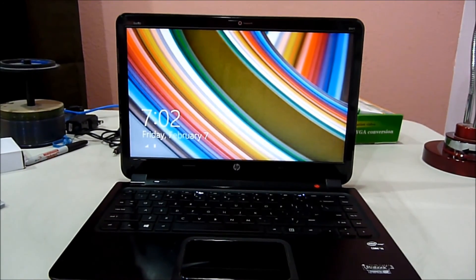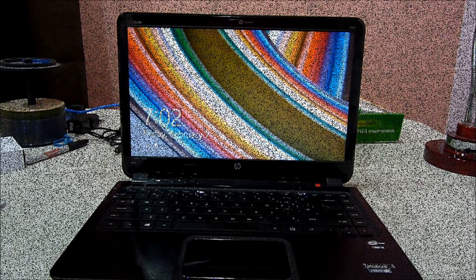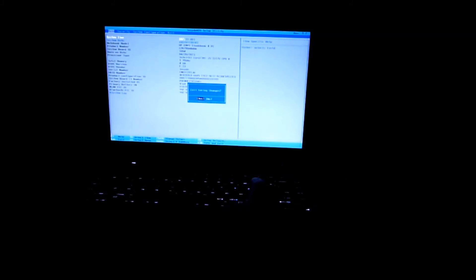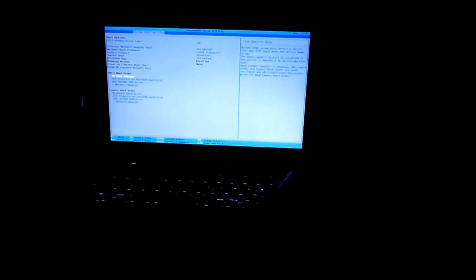This one right here is the BIOS that caused all the problems. You can't do anything with this — there's no AHCI setting. The boot option: you have to turn the legacy support on. So UEFI, we're not going to use; we're going to use the legacy boot loader.